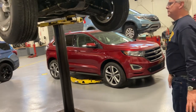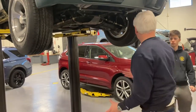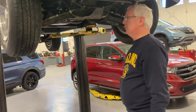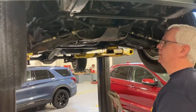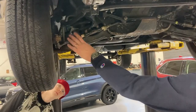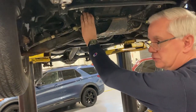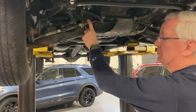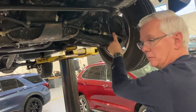So now let's do a little bit of lesson as far as steering and suspension components. This is what they call a parallelogram system. All of this — inner and outer tie rod ends — stays parallel to what they call the center link or drag link. Outer tie rod end, adjusting sleeve, inner tie rod end. Inner tie rod end, adjusting sleeve, outer tie rod end.